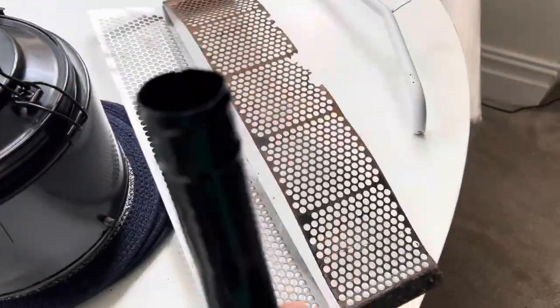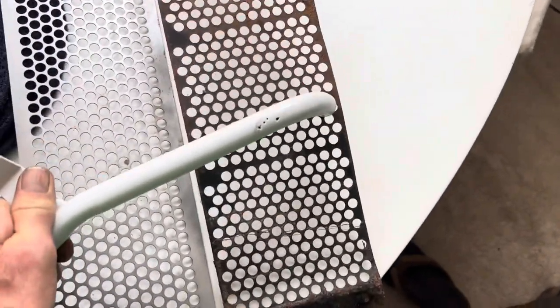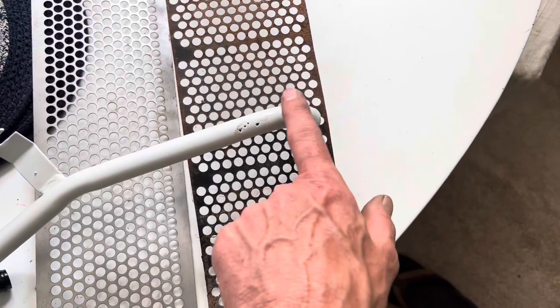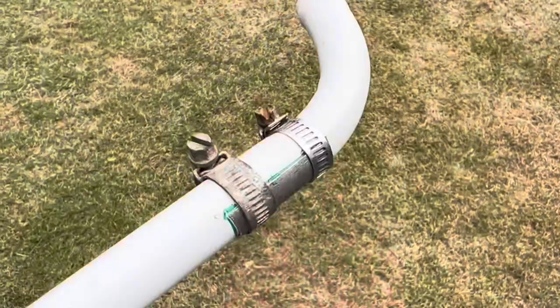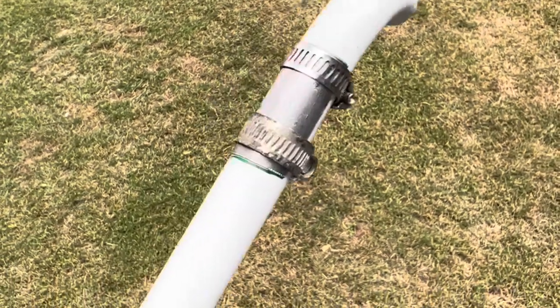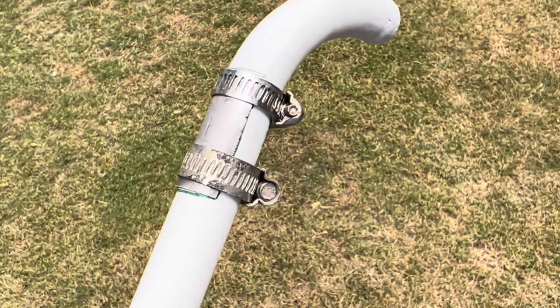One of the radiator pipes came back absolutely fine — it's a bit rough on those edges but that's no problem. The other one, unfortunately, once they sandblasted it, you can see there are these little pinholes. If you're on a budget, all you do is cut the pipe here and either use a longer bit of hosepipe or join a piece of copper pipe. The way I'm going to repair the pinholes is by gluing on a patch using the 3M panel bond that we used to repair the air filter.